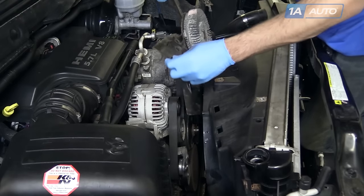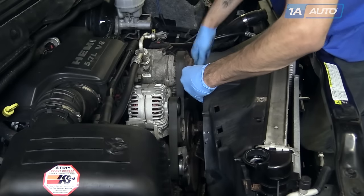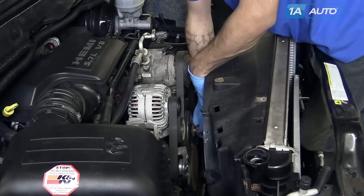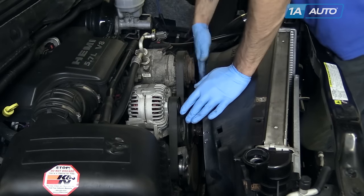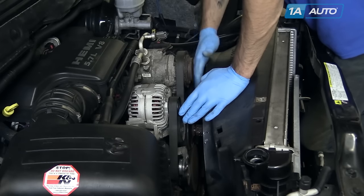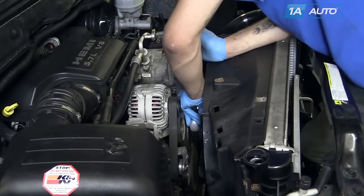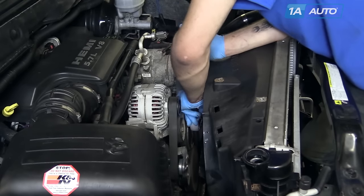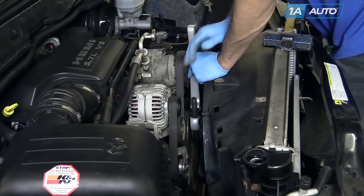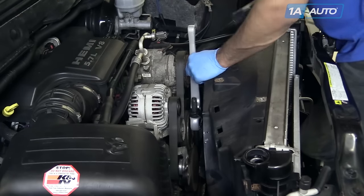Reinstall your cooling fan into the shroud. You should be able to start the nut by hand and spin it down pretty close using the fan. Finish tightening by adjusting your pipe wrench or pliers to the nut. Note that some water pumps are reverse thread — this one is not, so give it a few taps clockwise to finish putting it on.